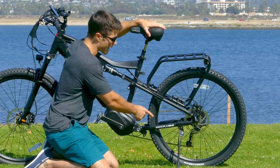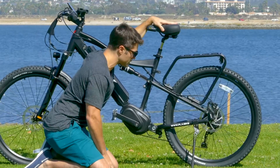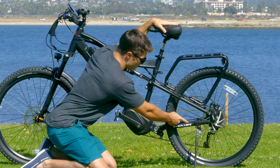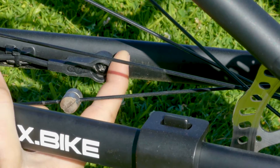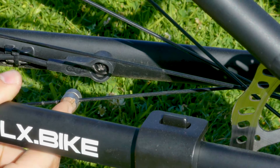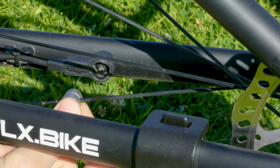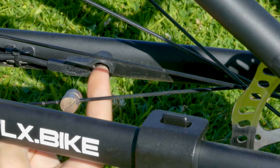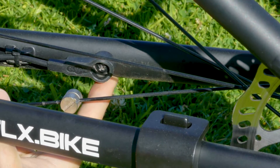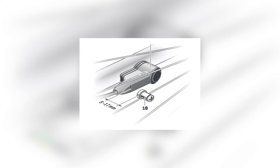What we're going to do is look on the back wheel of the bike. There's a magnet which goes by the speed sensor, and there's a speed sensor. You want to put those in line with each other so that the magnet and the speed sensor are in one level plane. This is a part that's really easy to get wrong. The magnet is also circular, but these are not meant to line up — it's counterintuitive. It looks like the magnet circle and sensor circle should go together, but this circular part is just a hole for the bolt that mounts the speed sensor to the frame. That's how it is on the Bafang system, the Bafang Max system, and the same with many Bosch systems.